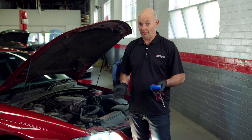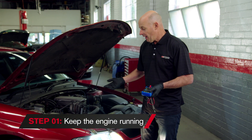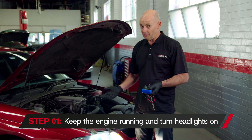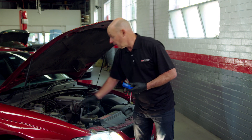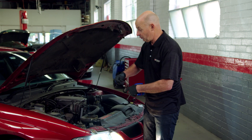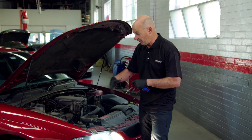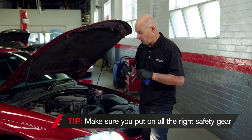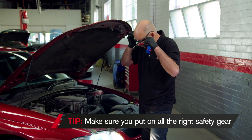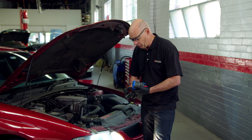I've started this car, I've got the engine running now, and I've turned the headlights on. So what we're going to do now is check the battery and the alternator. I'm going to put on my safety glasses because this battery's got a fair bit of acid attack around the top of it. It's sulphuric acid and I don't want any of that to get in my face or eyes, and that's why I'm wearing gloves on this job too.